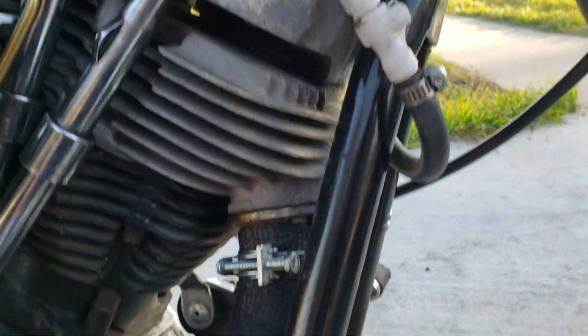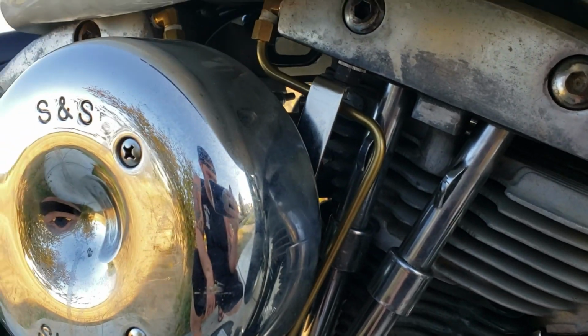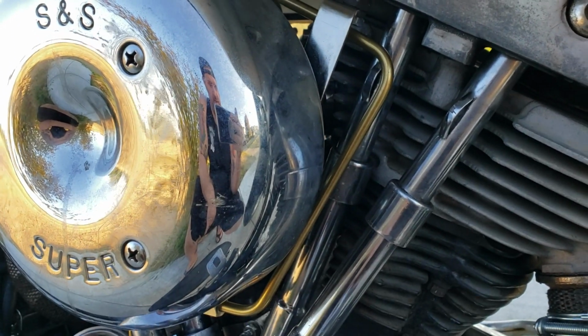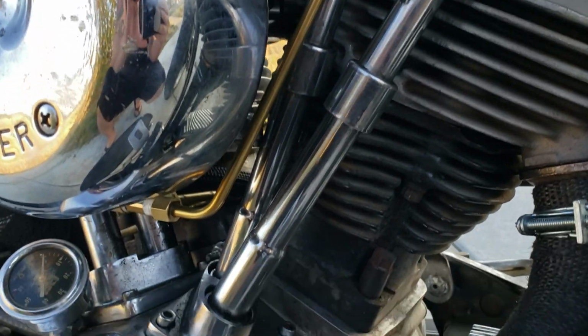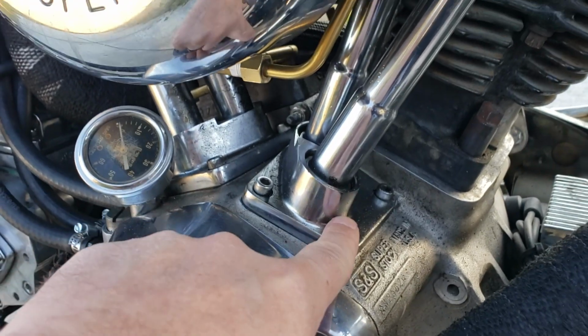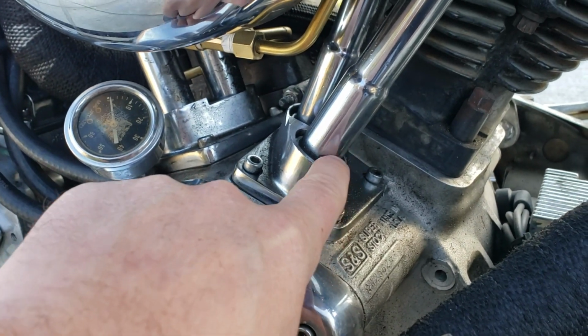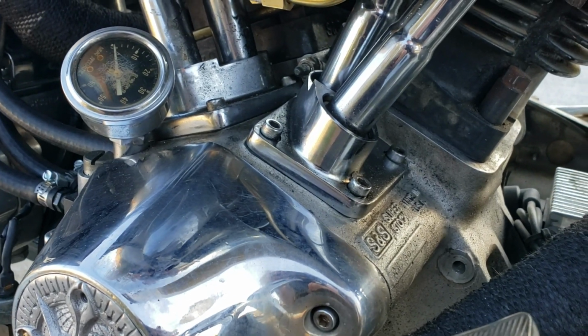And let's move around. Quick disconnects on the fuel tanks, which is really nice. New exhaust gaskets. Push rods adjusted. Does have solid lifters with adjustable push rods. All new seals, of course, in the push rod tubes. You do get a little bit of oil kind of blasting around here. It'll collect some dirt, but no major leak at all there.